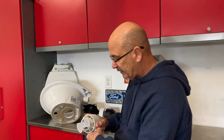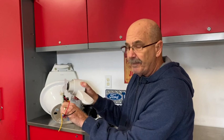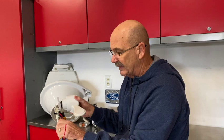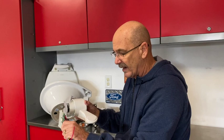The system is only activated by the foot pedal. You have a control board right here, 12-volt operated, with a butterfly valve and two contacts. Depending on which flush mode you have set, you can choose what they call the dry bowl flush — 0.21 of a gallon — or the regular flush, which is 0.83 of a gallon. As I highlighted in my last video, to program your flush modes, hold the pedal down all the way to the floor for 10 seconds to switch between dry bowl flush and regular flush mode.